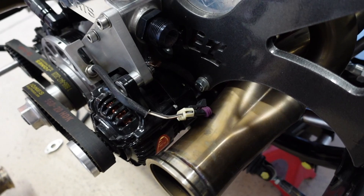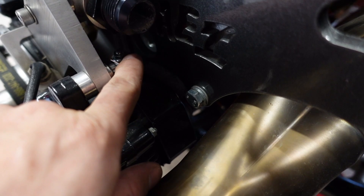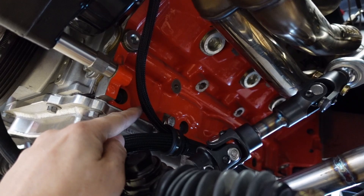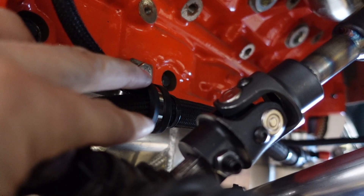You can see it right here — the threaded part on top of the alternator. It goes right behind through a little hole and then underneath in the Alex Tech sleeving like I talked about in my first video. The steering shaft is close, so I put a P-clamp here bolted to the block. I also have the oil line right here, so I got those bundled together.